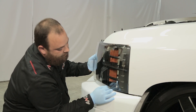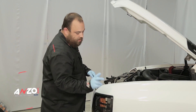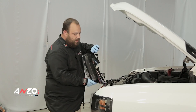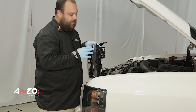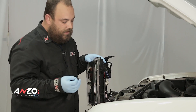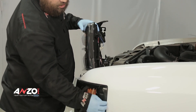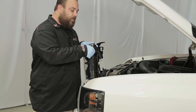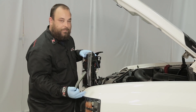As you can see, it meets all the body lines. I've got both sides in and confirmed the body lines are right. One thing to note: if you have a large gap, it's partly because we put a foam pad on the side during shipping to protect the edges. If you're experiencing a larger gap, remove the foam from the light and it'll seat all the way back so you don't have any gap issues and they line up properly.